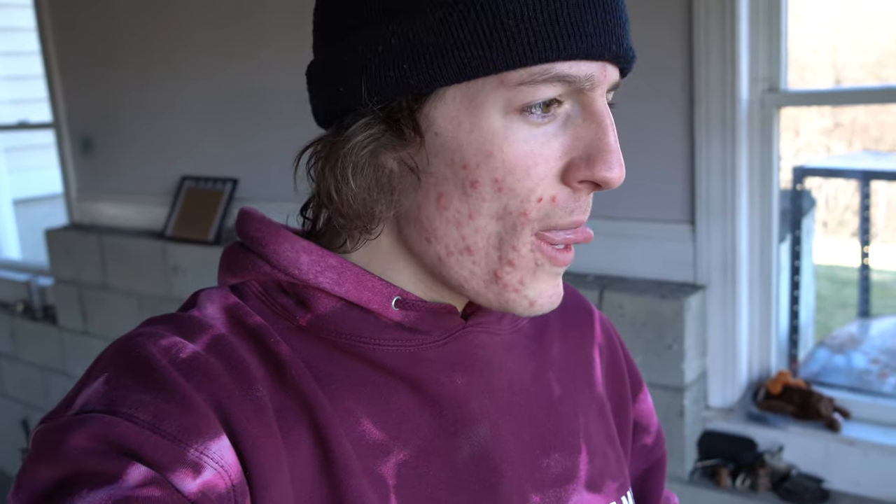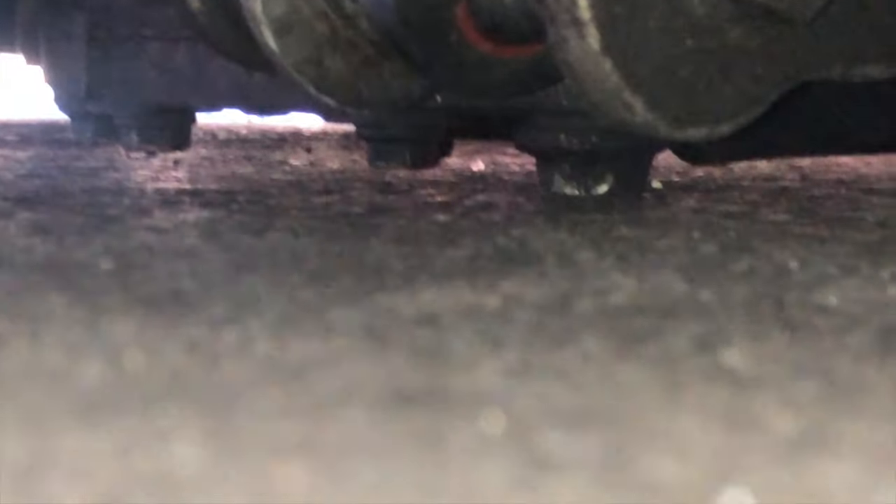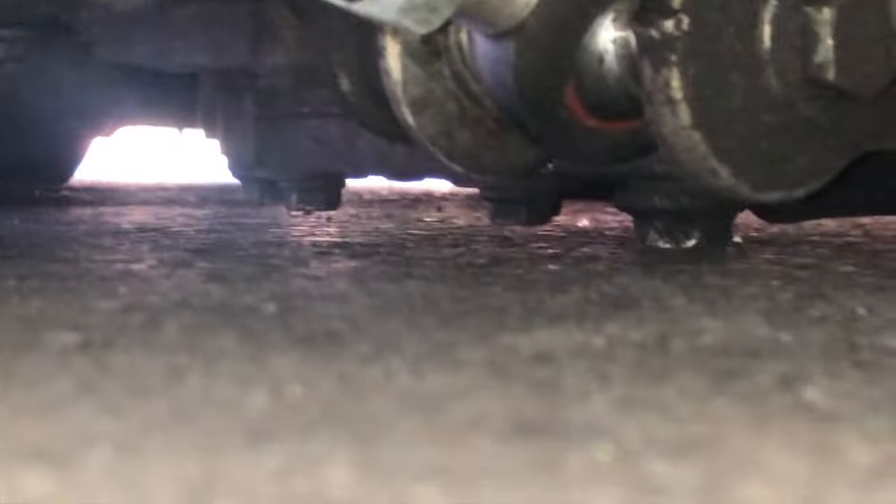The car has no movement - I tried shaking it, no movement at all, not even from the tires. I heard a little screeching noise underneath the car - the subframe is completely maxed out on the ground and one of the bolts is digging into my driveway. So even if I threw the stocks on in the front, the car could go no lower. There's the subframe bolt that's on the ground right now, digging in. The car cannot move, even if I pull the e-brake off.